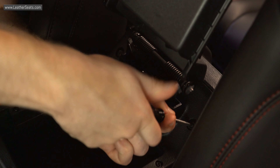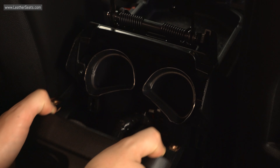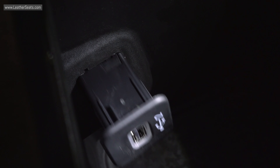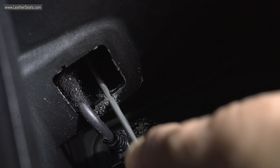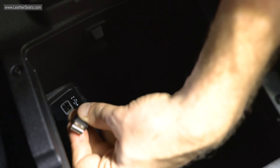To route the power wire, simply unscrew the back two T20 Torx screws at the back of the console base and pop off the rear trim panel. Pop the USB outlet out by depressing the release catches on both sides. From there, file a groove at the bottom of the USB outlet hole and feed the power wire through. Push the factory USB outlet back into the hole, leaving enough slack in the power wire to plug it in. If you'd like to avoid using this USB outlet and you have 12-volt experience, you can also hardwire it directly into the JL's 12-volt system behind the console.